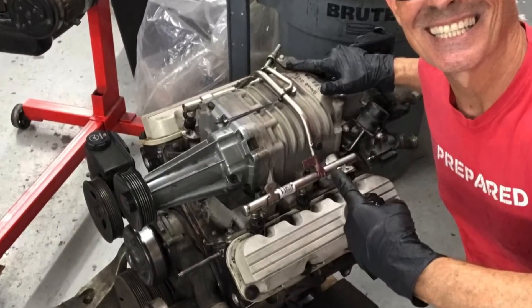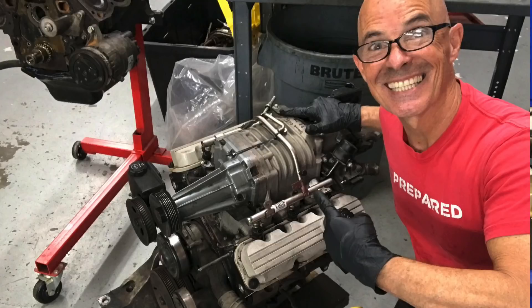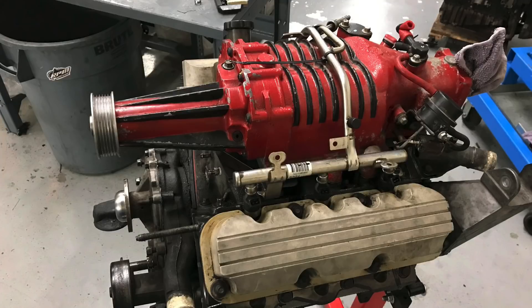Ta-da! All finished and hopefully ready to test. You can see we have our supercharged L67/L32 hybrid motor, because now it has L32 heads on it. We have that motor ready to go and fingers crossed it will go up and run on the dyno. I like the way this turned out — this is kind of a blessing in disguise. Putting the L67 intake manifold, blower, bottom end, and camshaft on this combination will allow me to do a direct comparison between the L67 blower and intake — because they are a match set — and compare that to the L32 upgraded blower and intake manifold.